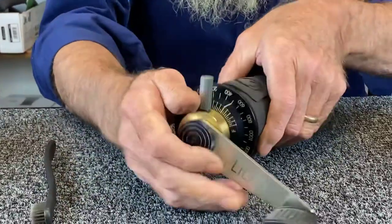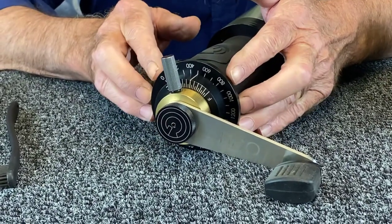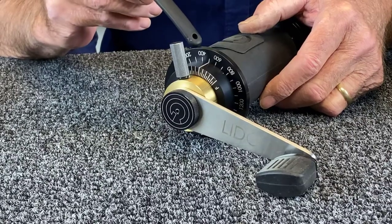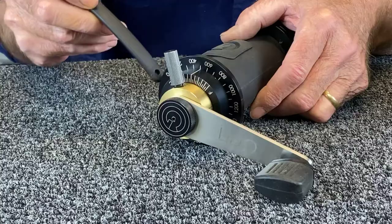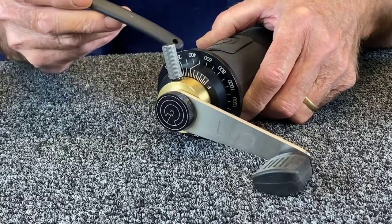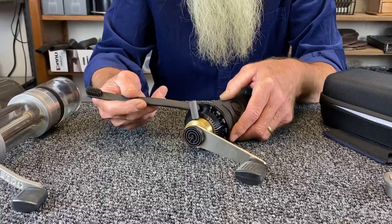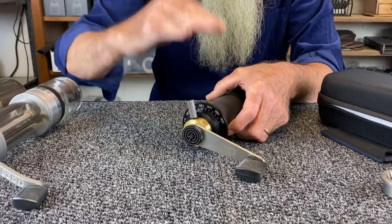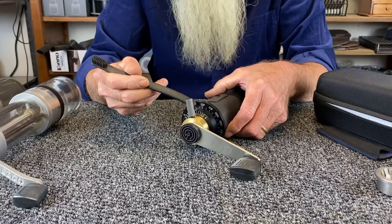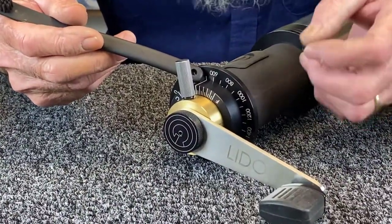That side port has allowed us to develop the main feature of the grinder: the dual adjustment system located on the top. The adjustment system has three components. The top platform is where you'll see numbers ranging from 0 to 2000. These numbers represent actual vertical burr movement of the cone burr in relation to the ring burr. At 0, the two burrs are nested together; at 2000, the cone burr has dropped down 2 millimeters, or 2000 microns. The vertical burr movement numbers are real numbers — not hash marks, dots, or revolutions to keep track of; it's actual movement of the burr.